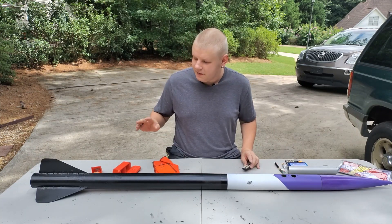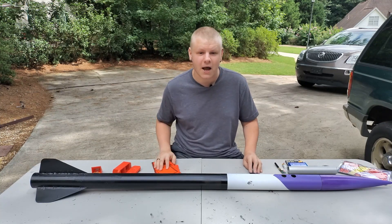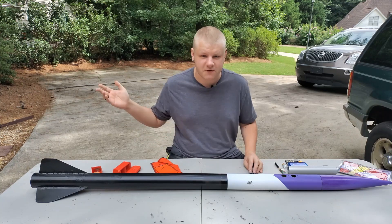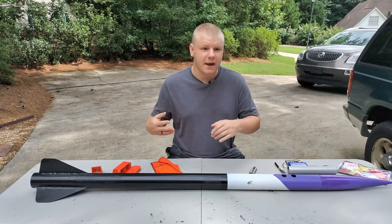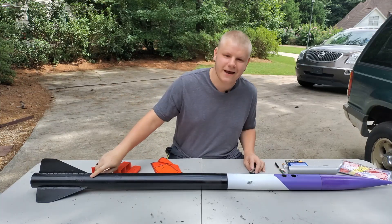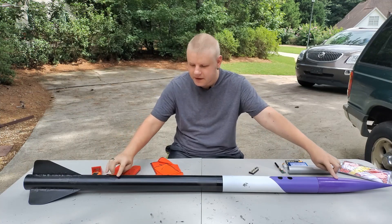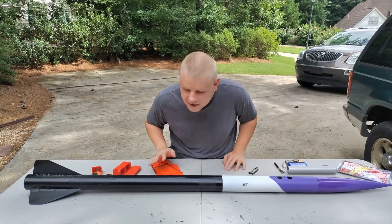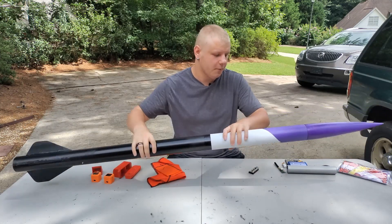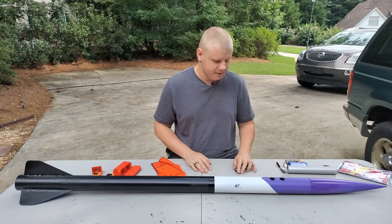Painting is where things really went wrong. The first hurricane of the season came through in early July — about a month early — and it's been non-stop rain basically since. Humidity has been like 80%, so I painted what looked like really good layers, then sprayed clear coat and it all peeled up. I peeled tape off here and it peeled up the paint. There's almost a scalloping effect — if I could do it intentionally it would almost look cool. This part was supposed to be black and fade, the masking went well, but the primer peeled up in a few places.